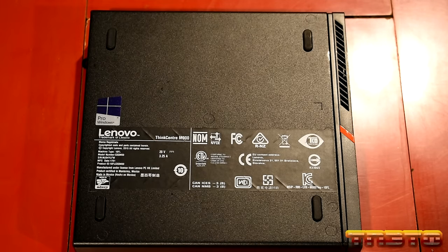Okay, and if that's a little bit blurry, I'll fix it for you, guys. There we go. So now we'll go down to UEFI. This is very important. You want to install Windows 10 via UEFI. If your system supports it, do it. So UEFI Sabrent, and that should boot us into our Ventoy. And it does.